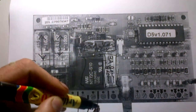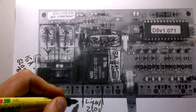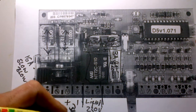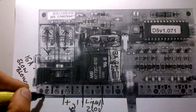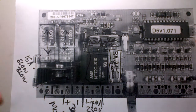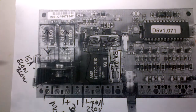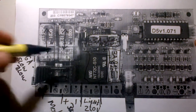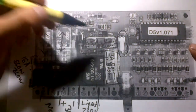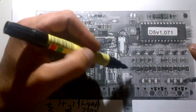This little relay is wired with this little fuse and that's all wired to the light output. That's your battery positive and battery negative. That is your motor — if you swap these wires around you're basically going to get polarity change and your motor will move either left or right, open or close, whichever direction you need.